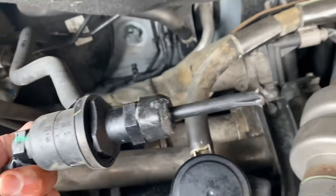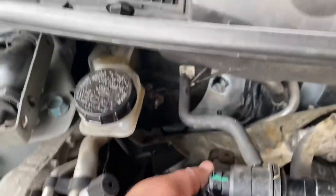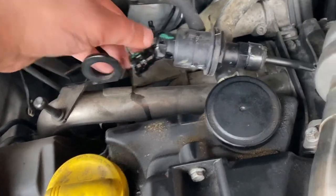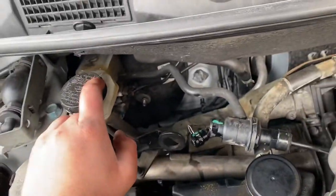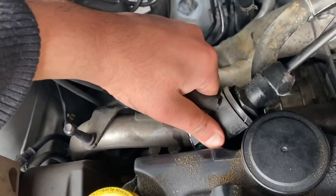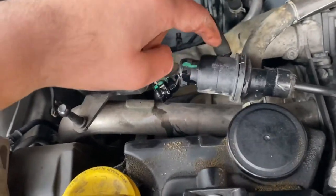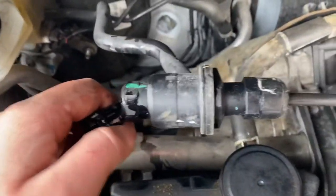This is what's broke — I thought it was the clutch but it looks like it's common on these cars. Once you've got that out, you want to disconnect this pipe which goes to where all your brake fluid is. Just pop a container or something under it so it doesn't leak all over. Make sure you twist this pipe off carefully with a pair of pliers, and then it should drain into there. That's the part you need to replace.